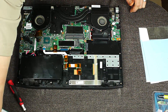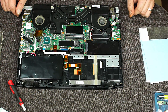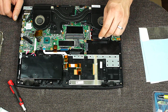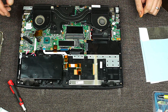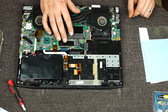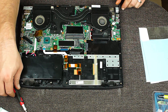Alright, now we've got the whole bottom opened up and we can see that there's definitely a lot of dust in these fans, so I am going to go ahead and pull this whole cooling assembly off. By the way, here's your battery. If I were to be replacing the other two DIMMs and going up to 64 gigabytes with 16 gigabyte DIMMs, I would have to take this whole board off - but I should just be able to take off the fans and cooling system here, so let's go ahead and do that.